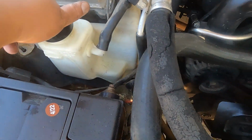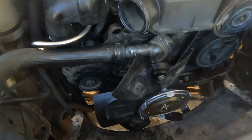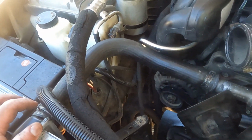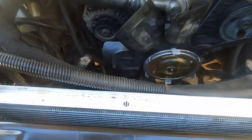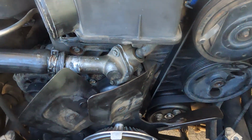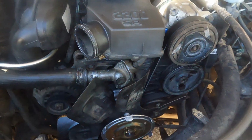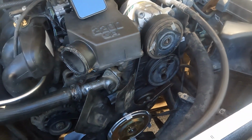It's all mud, because I got this one from the guys on the farm somewhere in Modesto. So they changed the radiator right here, but I think the coolant they never changed. So anyways, I'm almost done. Let me just put everything back, almost there, and then let it run with a radiator flush. I put everything back. I'm going to close up my radiator petcock, or the drain plug right here on the bottom. Close it down really good, make sure I got no leak.